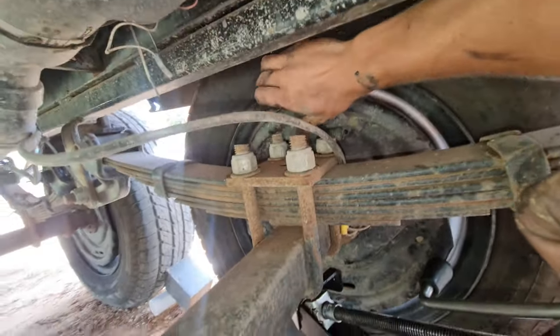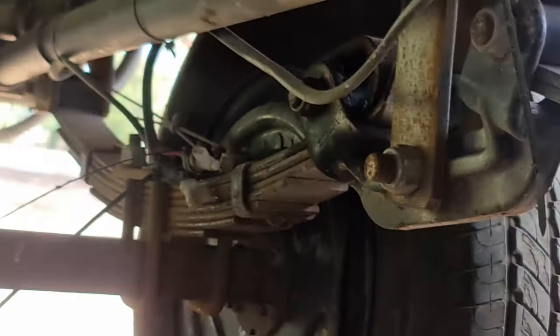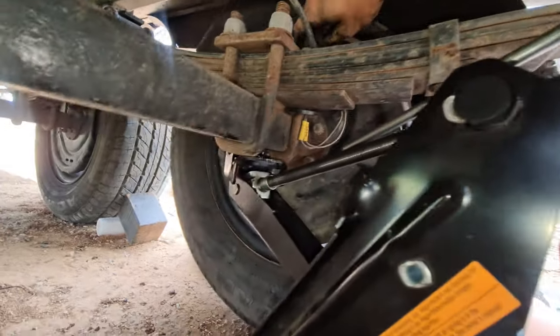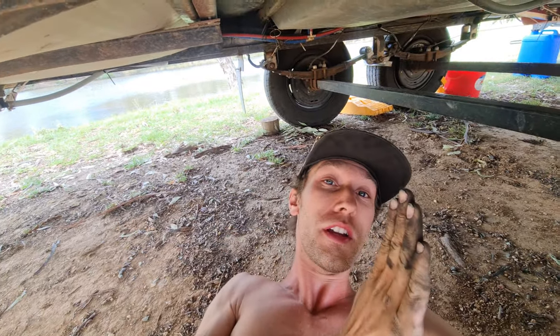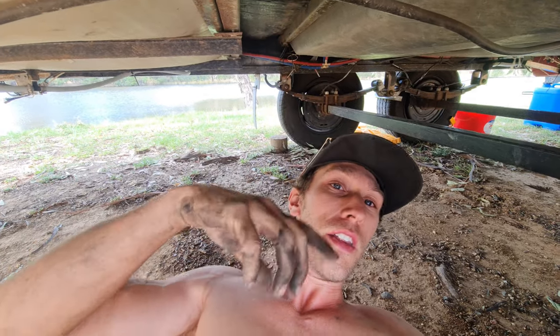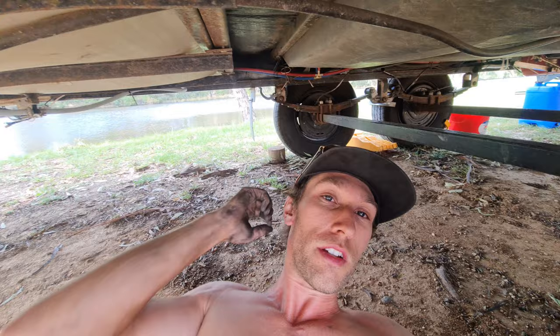This right here is the connection to the handbrake at the front when you have those cables coming up — see how there's a metal cable coming to it. So when you pull the handbrake, it just pulls that. Sometimes when you're adjusting it and it feels like it's grabbing, just do this with the handbrake a little bit — give it a bit of a push — because sometimes that'll recenter it. That might be giving you resistance because one side's touching it and the other side is tilted a little bit. So you don't want that, you want it perfectly centered. When you're feeling the resistance, just push the handbrake and if it eases up and it spins again, then you've got to tighten it a bit more. Just get it so it's nice and tight, push the handbrake, and if it's still nice and tight, just loosen it up a little bit until it starts coasting — and that is what you want.